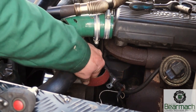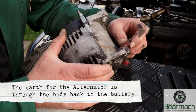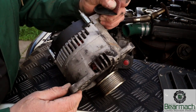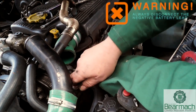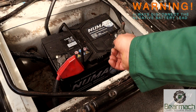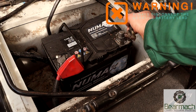Either wire brush or a bit of grip paper, and also on your alternator, especially if it's a second-hand one, you have the lugs which will make contact with the bracket - clean these up too with a bit of grip paper, including the one down the bottom. Not so bad if it's new. If you're working on electrical cables, make sure you disconnect the earth of the battery - this way you're not going to get sparks flying about everywhere when handling large cables.